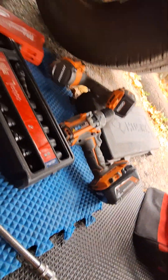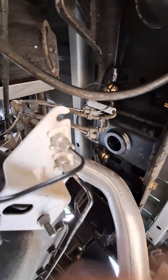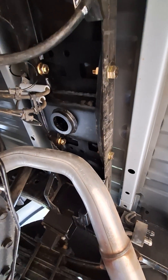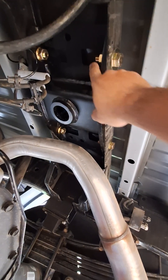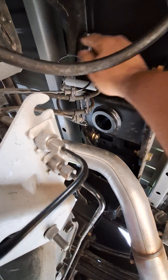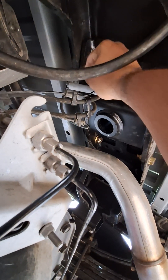I appreciate you watching the video — hit the like and subscribe button, it helps out the channel. If you need any help installing one of these Curt hitches, hopefully this answers some questions. I watched a couple videos and nobody's telling you that you need a 28 millimeter socket, nobody's mentioning to move this out of the way and pull this wire out and be careful — the washer can catch this wire if it's installed there. And that's 13 mil on the other side.